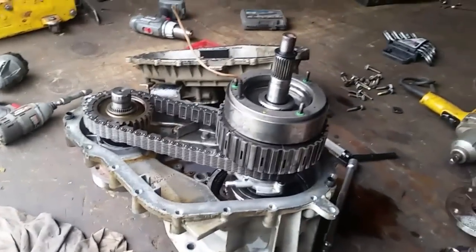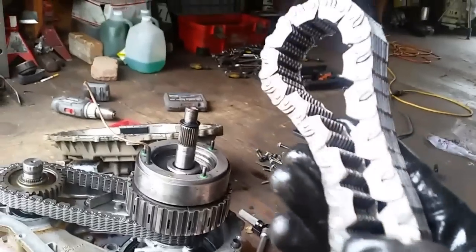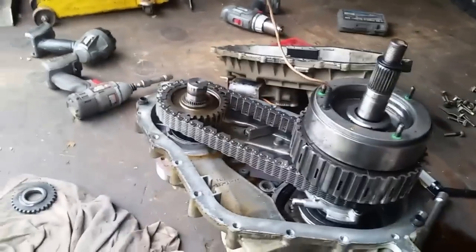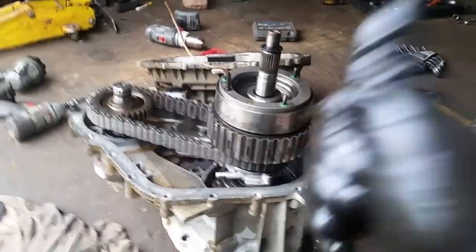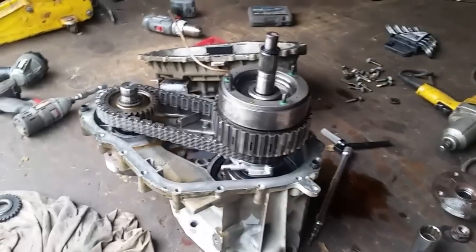It'll probably be a day or so before I can finish this up. I paid $79 for it — pretty chain, free shipping and everything. So we'll see if that takes care of the clunking. The old chain doesn't look like it's really all that bad, but I guess it's the stretching that causes the issues. When I measured them I couldn't find that much difference, but maybe the links on the old one were worn down quite a bit — the links on the new one look a lot thicker. So I'm going to go ahead and put this together and I'll see you guys back here in a few days with a final update. Until my next video, see you guys then.